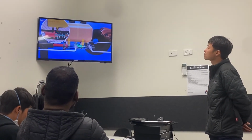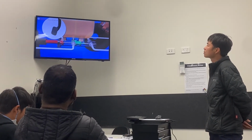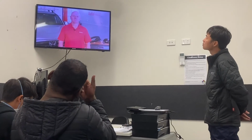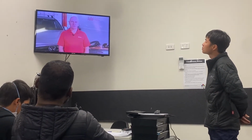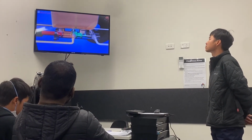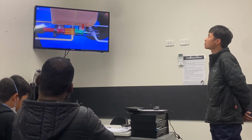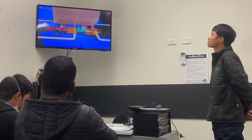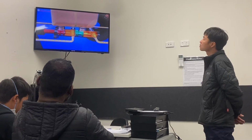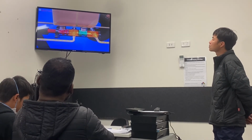Fluid flows through the compensating port into the brake pressure chamber in both the primary and secondary circuits. When the driver depresses the brake pedal, the pushrod moves the primary piston forward, covering the compensating port. This action traps the fluid in the circuit chamber, creating pressure and forcing fluid to the wheel brake units. The fluid pressure created in front of the primary piston acts against the rear of the secondary piston and moves it forward. As the secondary piston covers its compensating port, pressure starts to build in that circuit, forcing fluid through the outlet port to the wheel brake units. Further movement of the brake pedal increases the pressure in both the primary and secondary circuits and starts to apply the brakes at the wheels.